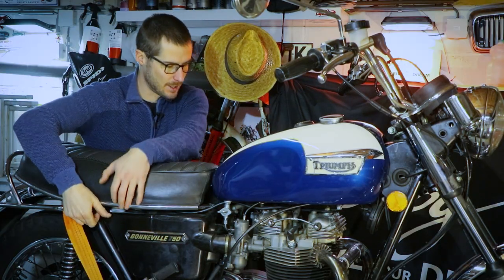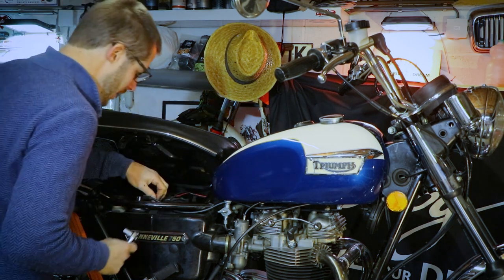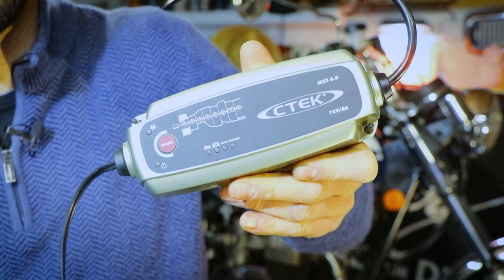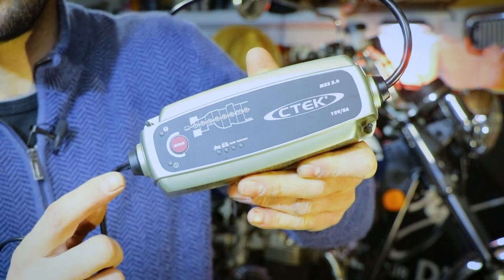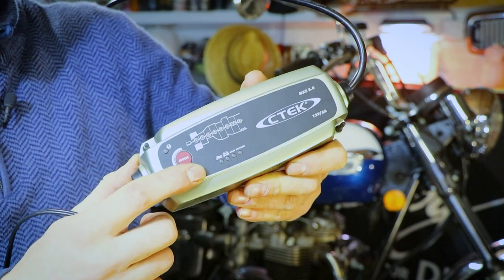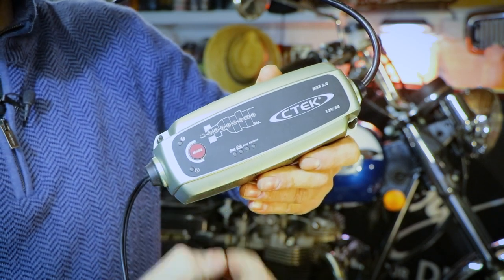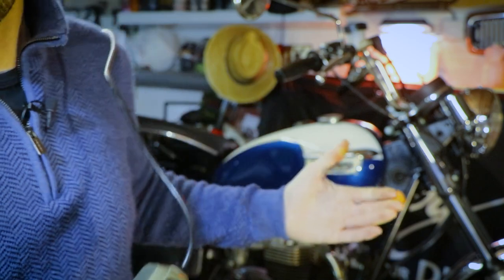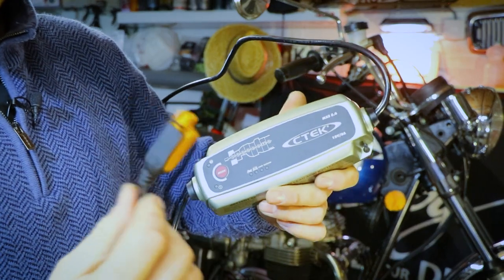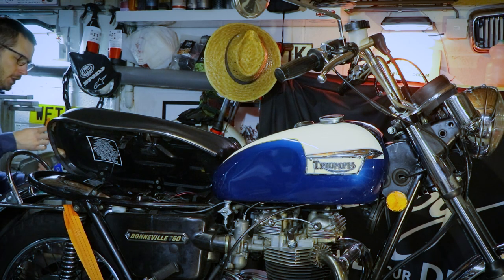I'm going to start by disconnecting the battery and removing the tank. There we go. And while the battery is disconnected, I will put it on charge. If you don't have one of these, I definitely suggest you purchase one, because these are very good. This is not a sponsored video, but what these things do is they not only float charge your batteries, but sometimes they also simulate draw of current as if you were using the starter motor, for example, which in this case doesn't have one because you have to kickstart it like a man. Anyway, I just hardwired this thing on the battery, so I'll connect it while I'm working on it. Why not?